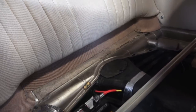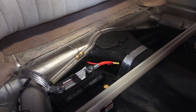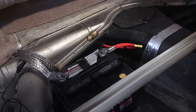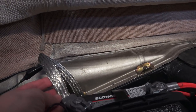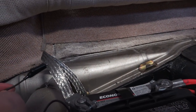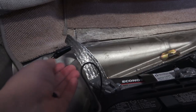Alright, let's get to it. I took out the back seat — it's easy access to the battery. What you see here is a brand new battery, and we are checking out the electrical system to see if the car has a draw. I have my ground strap here — brand new ground strap. I have the alligator clip on one end of the test light. So here's the test light: get the alligator clip and put it on the ground strap.